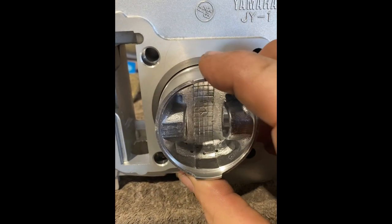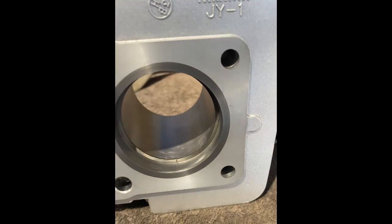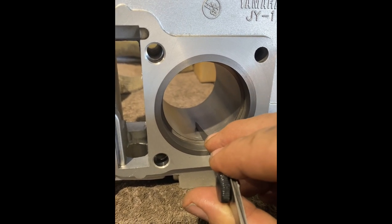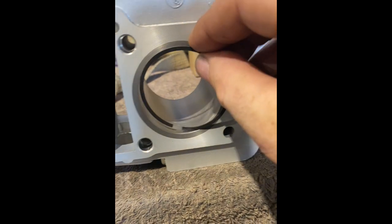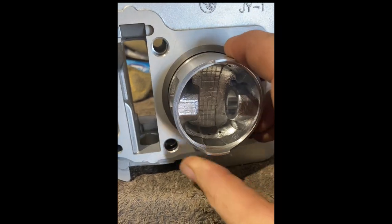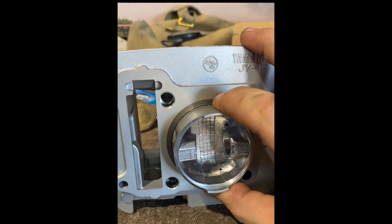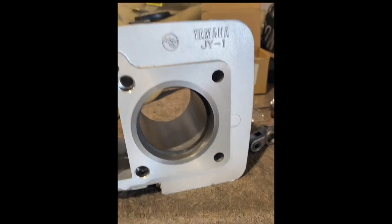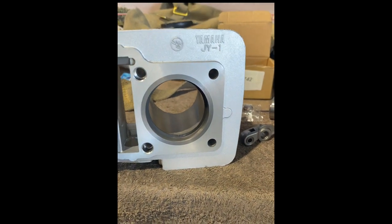One ring in — I'll seat it down to just past the oil ring groove itself. We're working around 9 thou ring end gap. There's an 8 going in quite easily. Just remember: whatever your bore size is in inches, multiply by 4 thousandths per inch of bore — this being a standard kids' bike with a cast piston. I've measured these and we are running at 9 and 10 thou. Absolutely happy with that. Once it's run in it'll bed its way in and the thing's going to seal up nice.